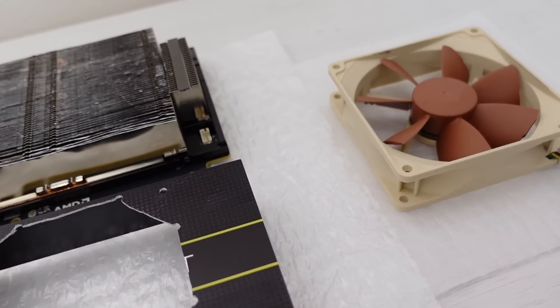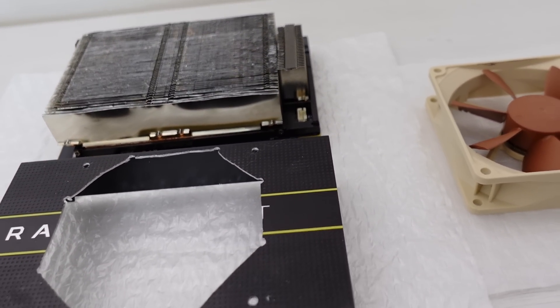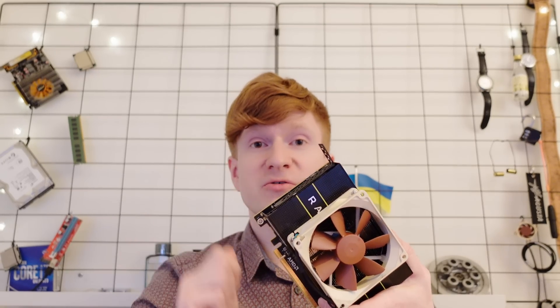The last thing would be to figure out how to connect your display to the MI8. The single DisplayPort on this graphics card is covered by the default I/O bracket which does not have any holes, because the card was not designed to be used in regular computers with a monitor. You can take some pliers or an electrical saw and cut a piece of this mounting bracket. Since I couldn't make it nicely, I just took a little piece of metal and made a small hook to keep the graphics card seated in my test bench for benchmarking.